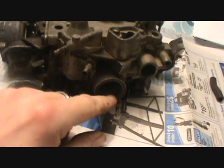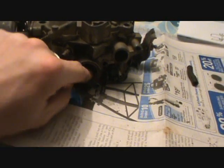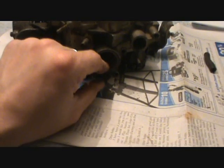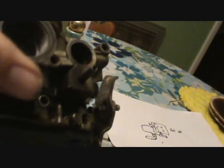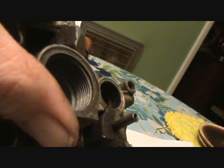I was going to mention something to you guys too. You ever see a Quadrajet that looks like somebody stripped the threads out of the inlet — whether it's one of the side inlets or the front — or they had to epoxy the thing back together and just use an external filter somewhere? Well, I'll tell you why they did that. Look real close on this — see that on the very end where the threads are? That's a nylon gasket that goes in that recess right there. It's actually still on this carburetor.